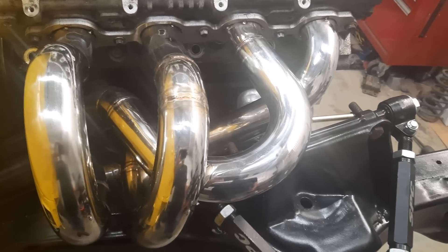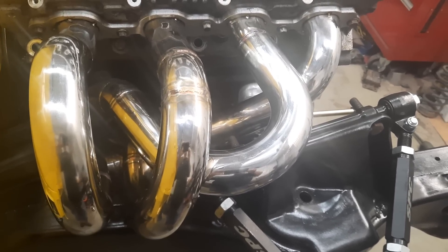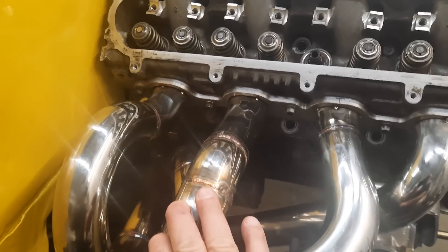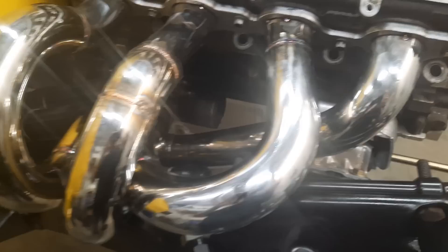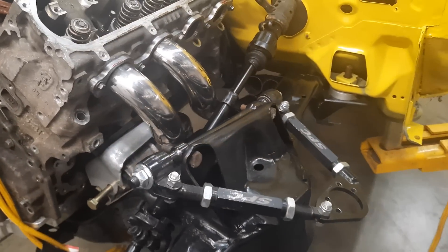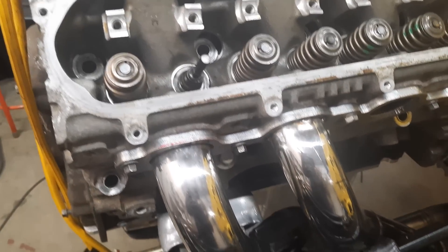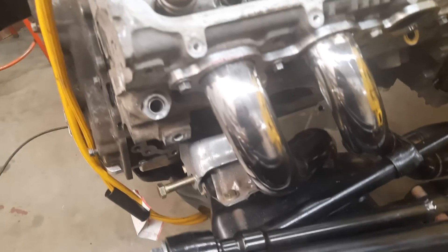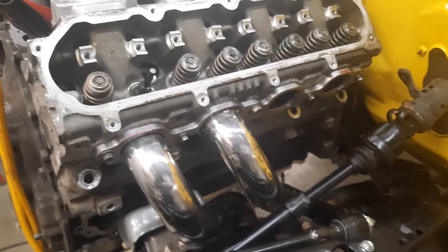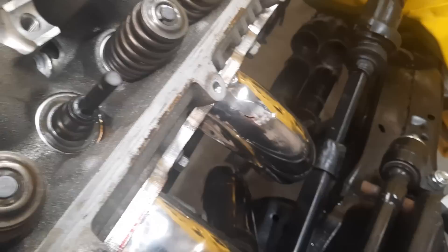This allows us to have each tube at an ideal length through the RPM range, and as it sweeps through, it shifts through various cylinders, while at the same time separating cylinders 6 and 2 in the collector from each other. We've started the same process on the other side. Steering becomes the big challenge there, but we ran the shortest tube — which in this case is cylinder 3 — to the collector, placed the collector, and now have cylinder 1's primary routed. Today's effort is building out cylinders 5 and 7, and we'll focus on bringing them into the collector in a rotation that matches the firing order.